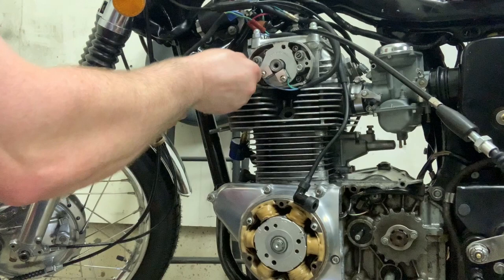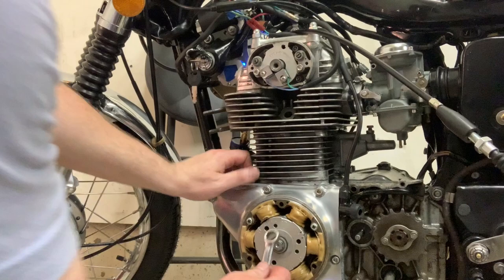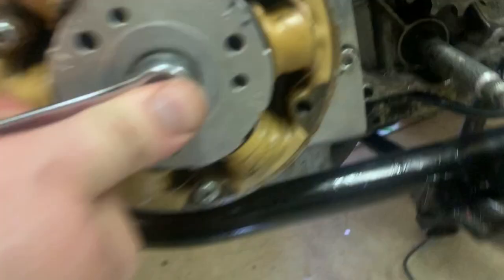I am just ever so gently moving this. Right there — let's see how that did it. I just manually did that, just kind of really lightly with pressure. I'm still on my LF mark, so let's give this a whirl. Turn this on, back up my motor, and go to my LF. Bam — right on the money. Right on my LF mark and my blue light just went off. I'm going to go back up my motor, see how my blue light came on, and then I'm going to rotate until the light goes off. The light went off and I am right on my LF mark. Good to go.